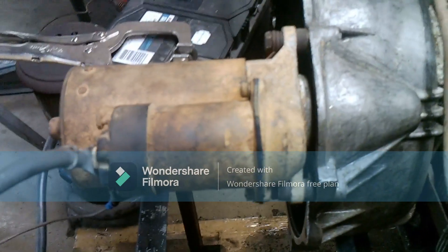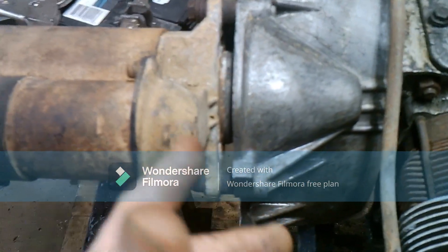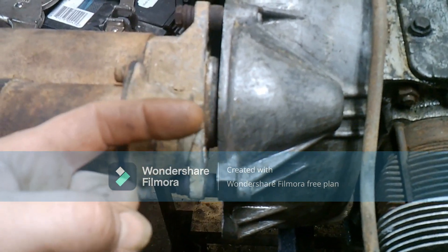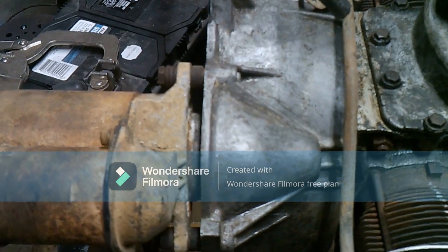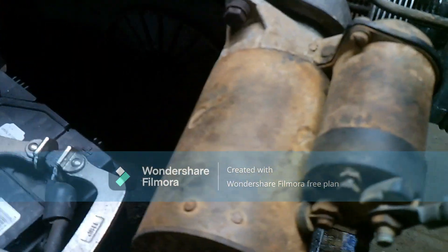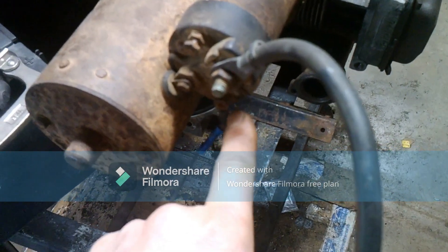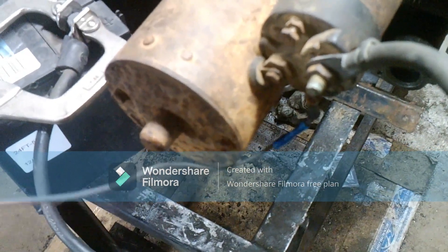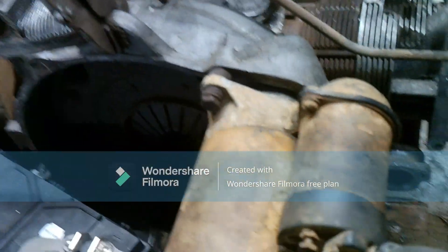Not a whole lot has changed with the engine itself except that it is now on this stand instead of the engine stand. What I have done is bolted up my starter. I got kind of freaked out initially because I was like, holy crap, the nose cone's hitting inside here — and then I remembered, oh yeah, this usually comes through the transaxle flange, which sits between here. So I had to put little spacers in there, as you can see. I've already tested it — it does crank. I've got my positive hooked up over here on the big post, this is the S post on the starter that goes from the switch to engage it. You just touch it to the positive, and of course negative is grounded to the bell housing — grounded to the engine.